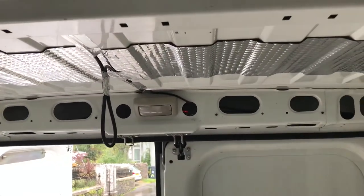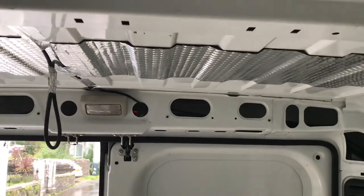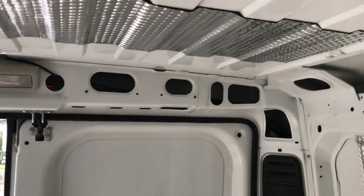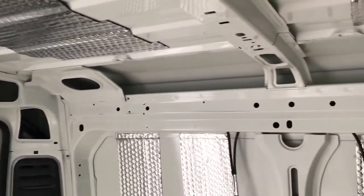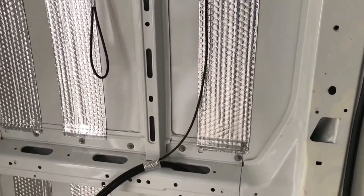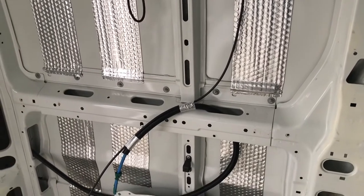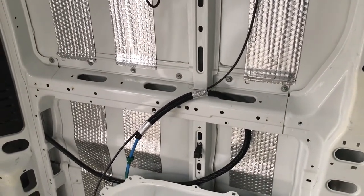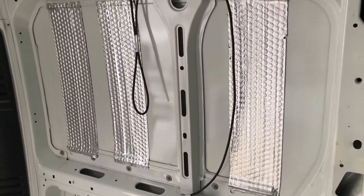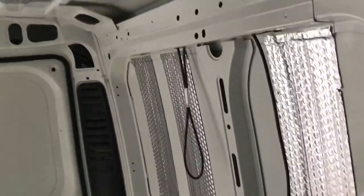The lights will be kind of low consumption, but when you take into account the length of the cable run it kind of decreases the capacity of the cable — derates it. So it runs along here down into the final light and into this panel. Above that I'm going to have a 240 volt socket and a USB. Due to the size of the lights they're going to be switched themselves — touch lights.